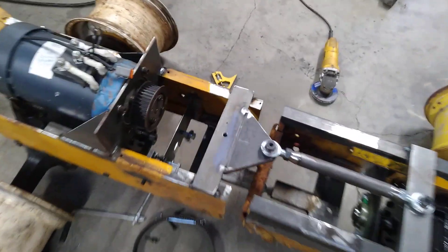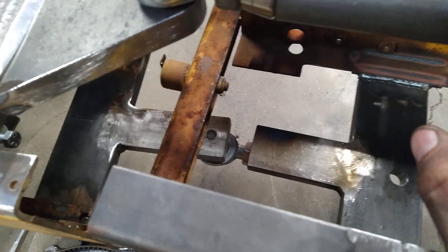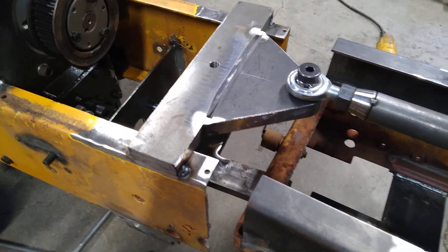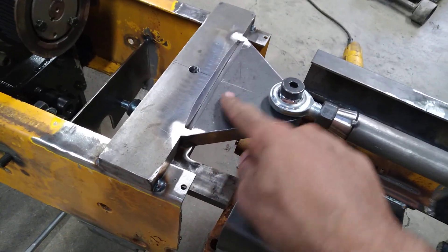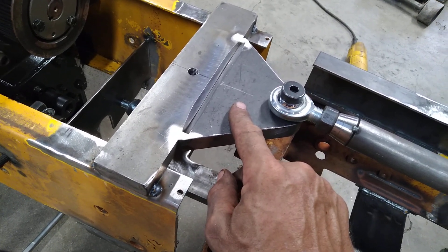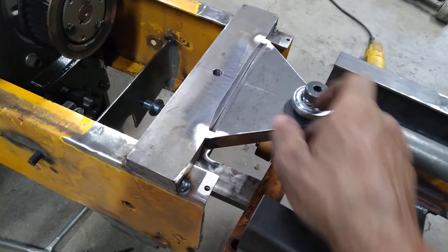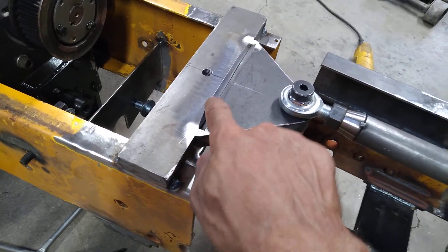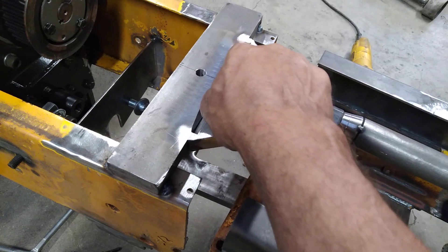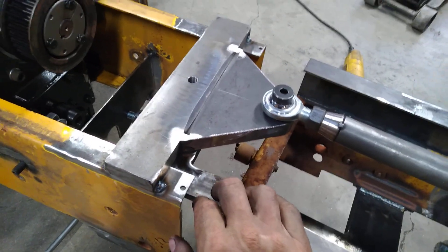So I made up this little bracket. This is a whole lot like what's down there. I just got a cross piece right there and then there's a two-inch piece coming off of it, and that's where the rod end is on the bottom. I didn't want to do that on the top because I think it'd be more visible, so I made it look kind of cool. I just used three-and-a-half-inch wide by three-quarter flat bar and cut some triangles on it and rounded this thing off to make it look kind of nice. And like on the bottom, I notched this out real good on top and bottom, and whenever I finish weld this thing, I'll come back and fill that in and flatten it off.